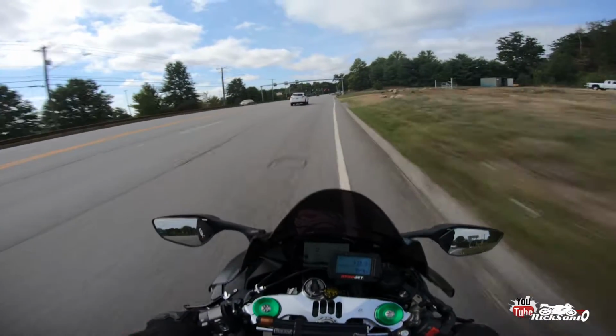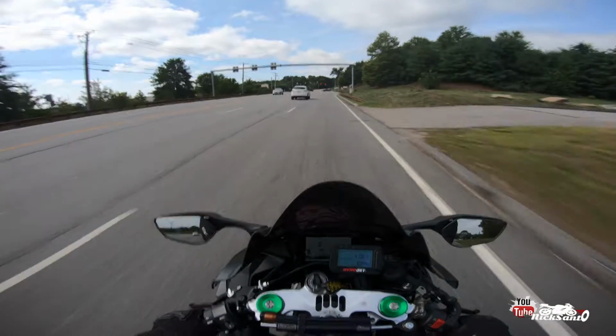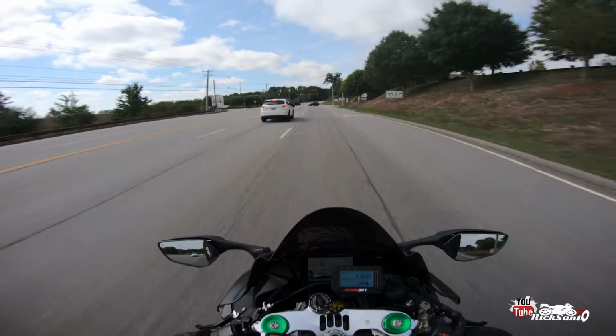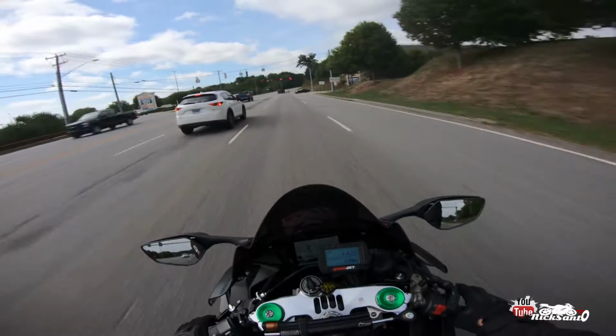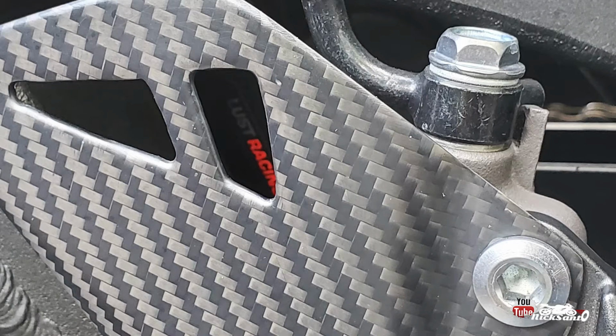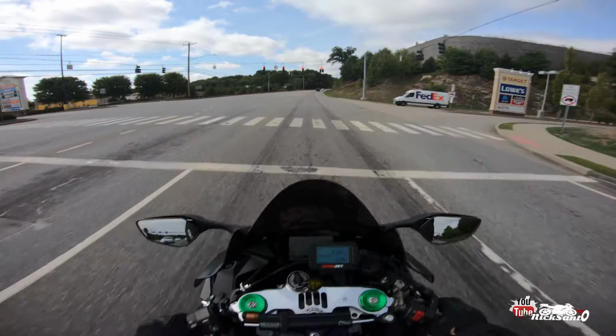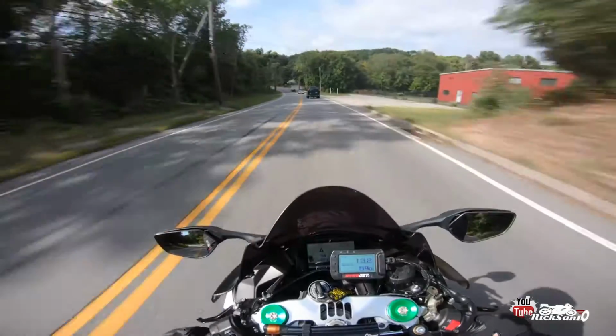Of course, torquing everything back down. You want to torque all those bolts to 26 foot-pounds. And then on the rear set on this side, it's like 18 something. I just set them to 19. I had it set to 19 foot-pounds.